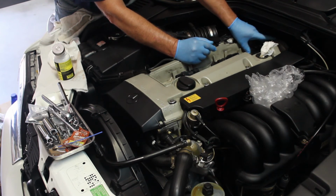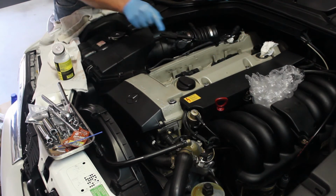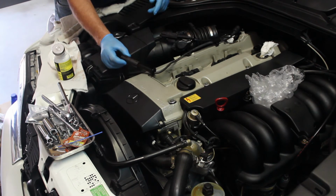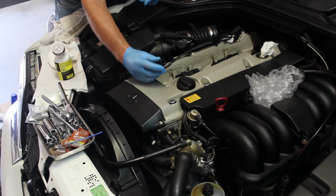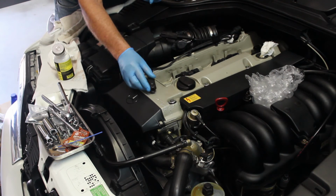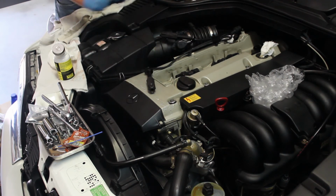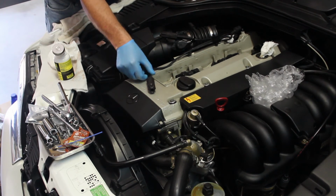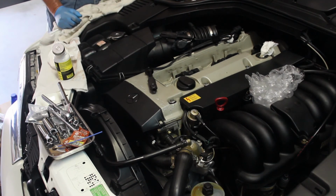3. And these are a wasted spark system, so that means it's actually sparking 2 plugs at the same time, but only one of them is igniting the fuel. So on these parts here, I'm going to put some silicone grease on these as well and insert these, and I'll put some silicone grease here, just a little bit so it goes in easy. I'll get this wiring harness installed, and we'll come back and take a look at it.